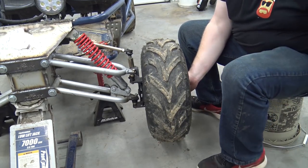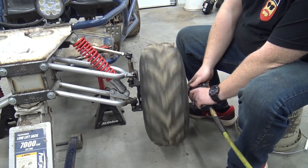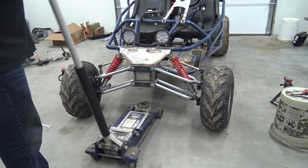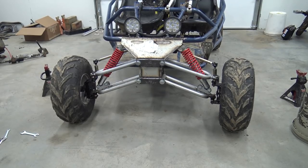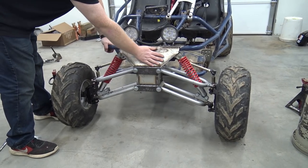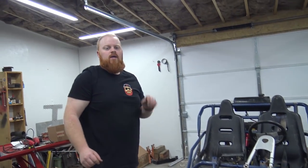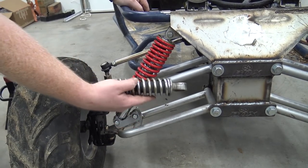Bam, thing is golden — it's about to be lifted even higher than it was before. That's huge, that's awesome. So now I just have to tighten down the shock bolts and grease the A-arms where they hit the bulkhead. This thing is going to be a whole different monster. Before, you would ride across the yard at 20 miles an hour and the shocks were completely bottoming out.